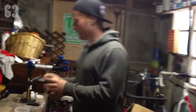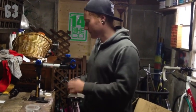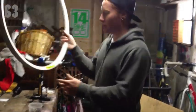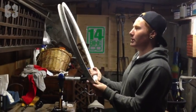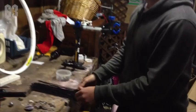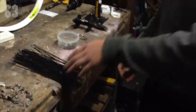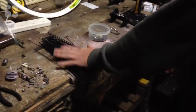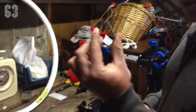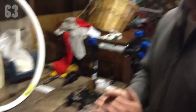There are a couple of things you're going to need. First, I've got a Sadio SuperSpark hub — this is a 32-hole front hub. Then we've got a Velocity P35 32-hole rim. Obviously we've got some spokes here. You can get your spokes measured up from a bike shop if you can't be bothered to research the measurements on the internet. I already knew the measurements, so here are the spokes. Some nipples, and you're going to need a spoke key as well. This is a flathead screwdriver — you can use this later on, I'll show you.